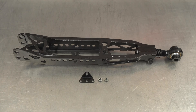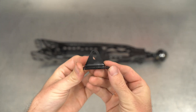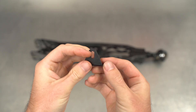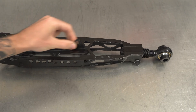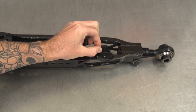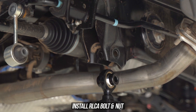Now that we have our length set, let's end with the most delicious part being the small little bent Dorito chip. If you were blessed with this sensor, you'll notice it on your lower control arm. If not, you can skip this segment. There are three holes to adjust, and depending on where you set your lower control arm adjustment is similar to where you would set your Dorito. We would suggest comparing off the OEM LCA and going from there. We weren't blessed with these features, so we will be raw-dogging that Dorito no-salsa style instead and can now move on to the rest of the install.